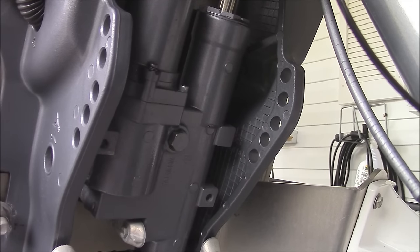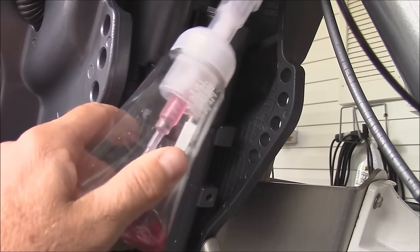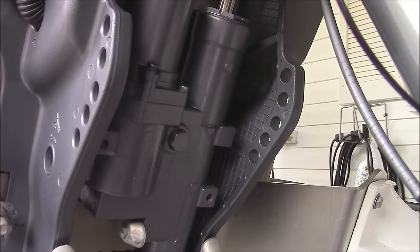Now, let's say you have the same issue and it's stuck in the raised position and you can't get it back down. If you hear the relay clicking and you think it's out of fluid but you need to get it moving to get that 18-millimeter nut off to fill it up, you can tap right here on the top of the motor. Sometimes the bushings stick, and tapping it should get it going again.